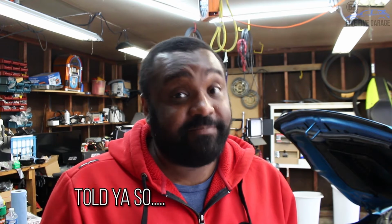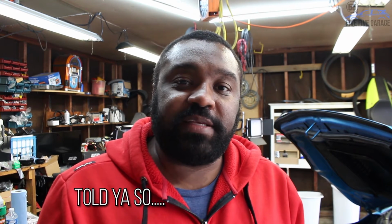Okay, so project update. It seems I've hit a little snag, as can happen with these things. There is an issue with the sensor for the boost gauge. It is a 1/8 by 27 MPT fitting. Unfortunately, on the Shure Motorsports vacuum box I put on the car, the fitting is the wrong size, and I could sit here and kind of butcher together this setup, but I want to do it as cleanly as possible, so I am just going to stop filming right here.